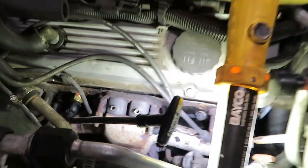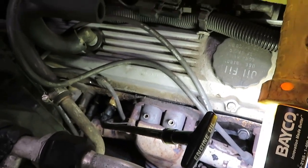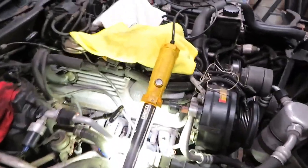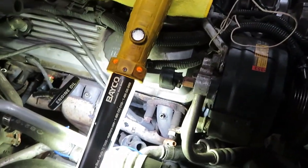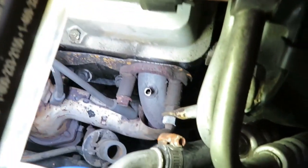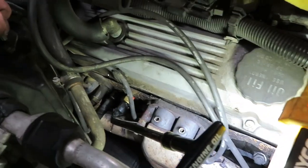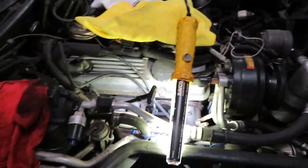What we're gonna do now is fill these holes up with JB Weld just enough to block them off, and when I get this thing home I'll throw some weld on top of each one. I can even go as far as threading it and just putting bolts in. If you don't have a welder you could do a nicer cut, thread it up, screw a bolt in and you're good. But I've got a welder so I'm just gonna weld it and make it permanent.